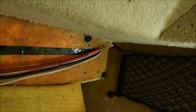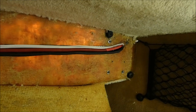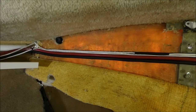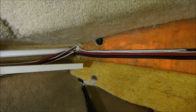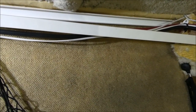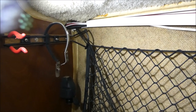All the heavy cable from the control box in the anchor well is routed through the front of the V-berth. Double sided tape was then applied to get a nice straight line with the cables across the fibreglass face in the V-berth, which stuck the cables onto the wall quite well. The sort of double sided tape we're using is that used for artificial turf, so it's waterproof, weatherproof and has high stickability. The control cables and power cables will then all go through a square conduit which is being glued to the side of the hole using high strength silicon, and that gets routed through the rest of the boat through cupboards and lockers to the circuit breaker back towards the battery system towards the rear of the boat.